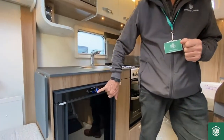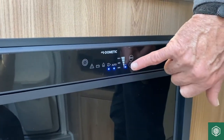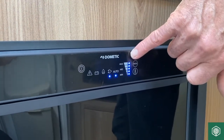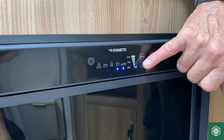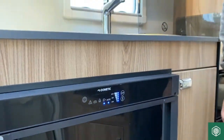And this is the thermostat control — it's this little thermometer button that you press to change it. So that's number one, two, three, four, and five. The higher up the scale we go, the colder the refrigerator is going to get. So five is the maximum — in other words, the coldest setting — and one is minimum, more for winter use. Two or three is probably for spring and autumn typically, and four should be your summer use.